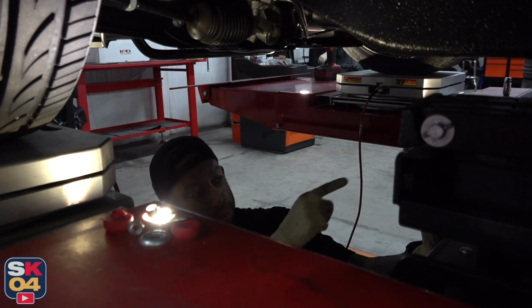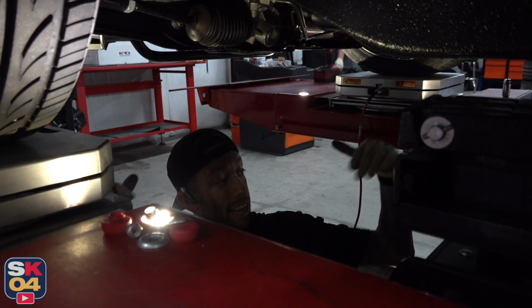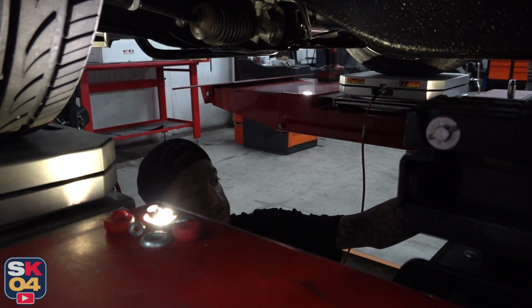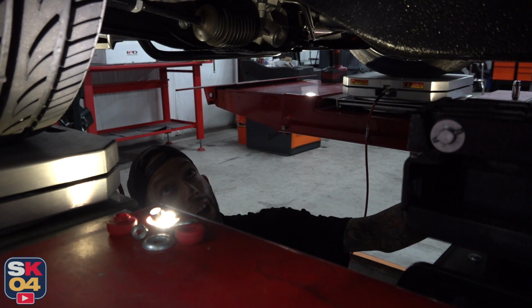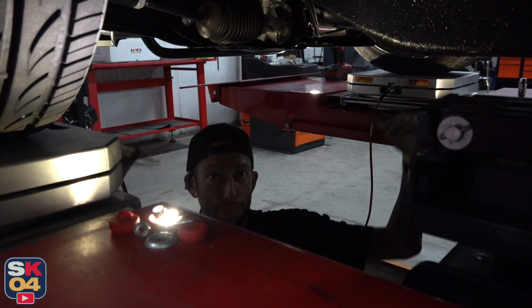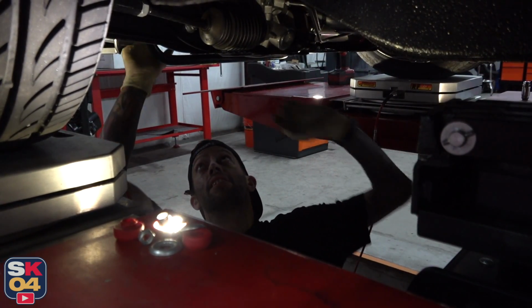Because when we initially picked that corner up, it fixed the weight, but the ride height was still really wonky. So we had to level the car out, and it put me kind of in the same spot we were in at the beginning. So now I'm doing the fine one turn here, 3 turns back there to get my weight back kind of where I want it. So let's see what it does. Go from there.